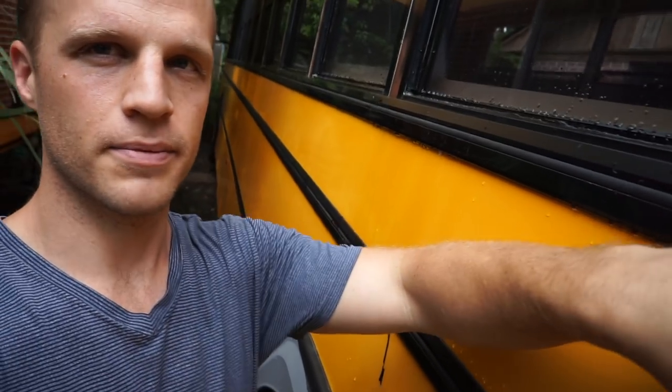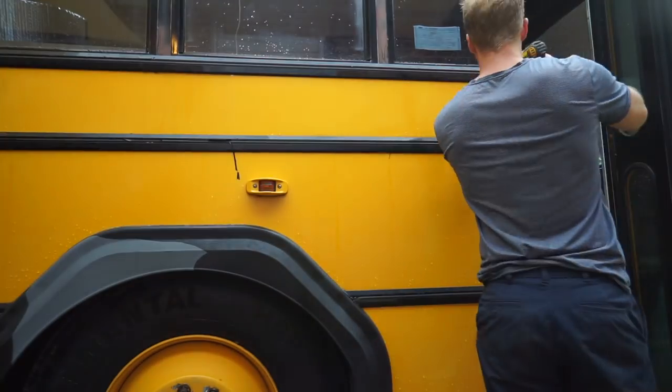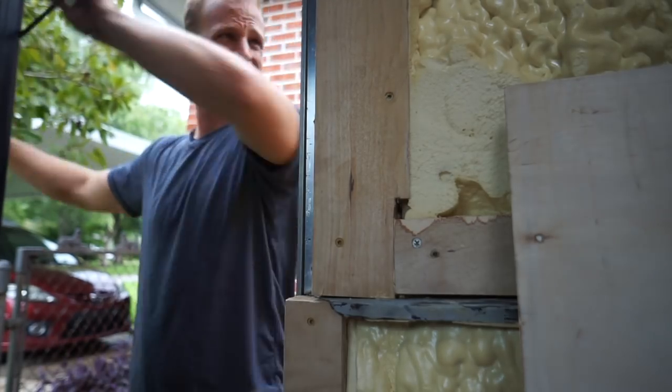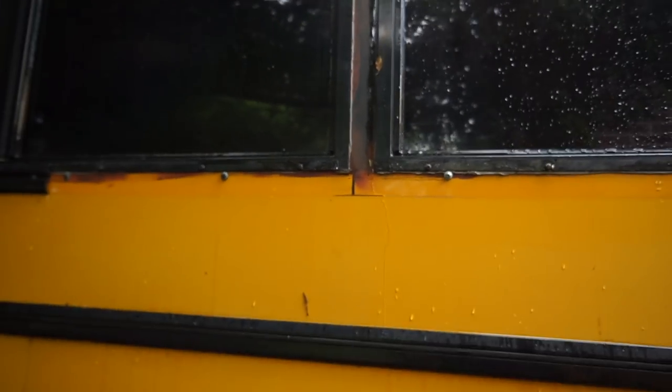I'm gonna go talk to Jeff. Okay, it's done raining for a while and I went next door and talked to Jeff — you know Jeff from the sealing video, that was our last video. I keep going and asking Jeff about things because he's just got so much experience with everything. What Jeff said basically was: when I reinstalled these windows I sealed the bottom and I should not have done that, because if water gets through things it's got to find its path out. What he suggested I do is uninstall. I do think a lot of this would have been avoided by not sealing that bottom piece, so I kind of recommend that you don't seal it. But I already made a video showing you how to do this and I feel like I failed you. I'm sorry about that.